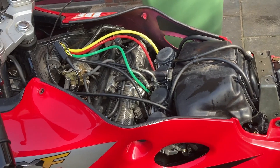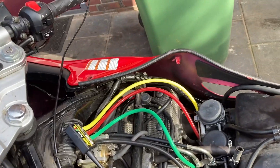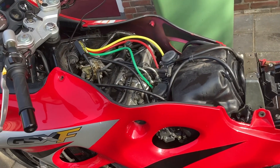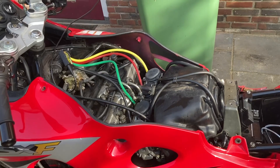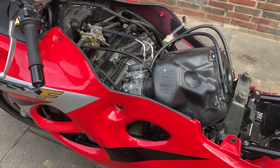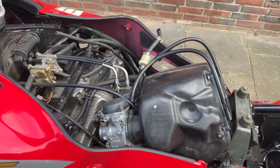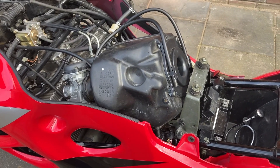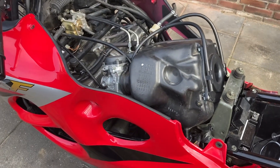Now I'm just going to put everything back together and take her out for a spin to see what's going on. If it hasn't gotten really better, I'll do some further investigation — maybe some adjustments with the needles or the idle mixture. Actually, while I'm here already, I'm just going to add half a turn on the fuel mixture screw. It's been really close to the limit, so it's more of a soft issue — this way we're not going to have more problems with that.